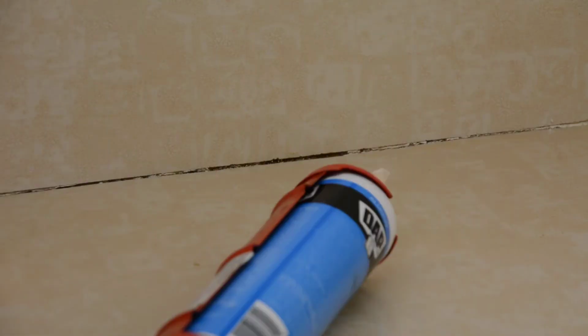Now at this point, we've removed our old caulking strip, or whatever you call that thing, that's in the place of where caulking would normally be. We cleaned it well, we got all the double stick tape off, we got all the gook off, and then we cleaned it with alcohol. Because the cleaners that we use to get all the gunk off, there's oils and stuff in it, so we clean it with alcohol to get all that off. That way the caulking will stick better.